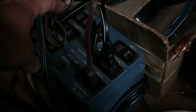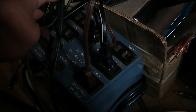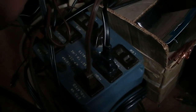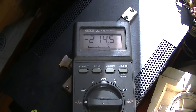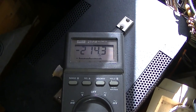Before I do that, I think I might have found the problem that caused most of this. I'm running this thing and somehow it ended up plugged into the high output on the ISO tap. And I usually run it on the lower voltage — I usually try and run them around 115. Let me see what it measures. I measured my line voltage and I was putting 123 volts into the television and I had 228 milliamps.